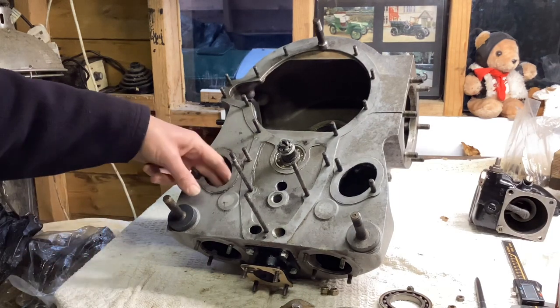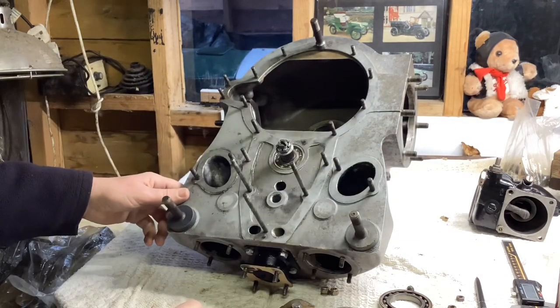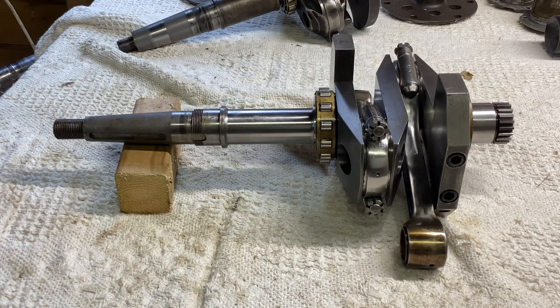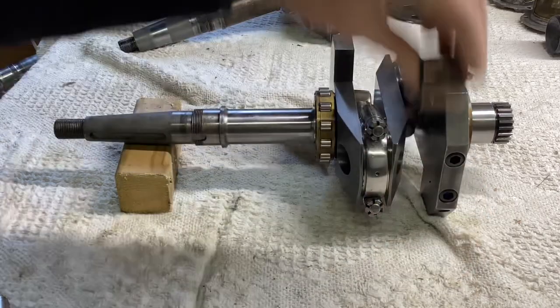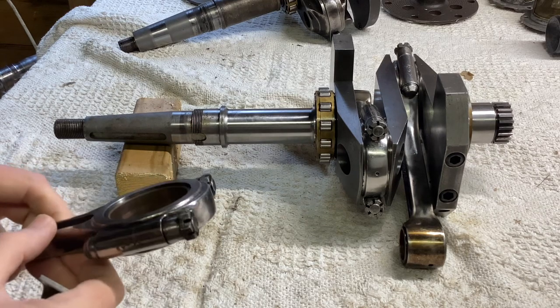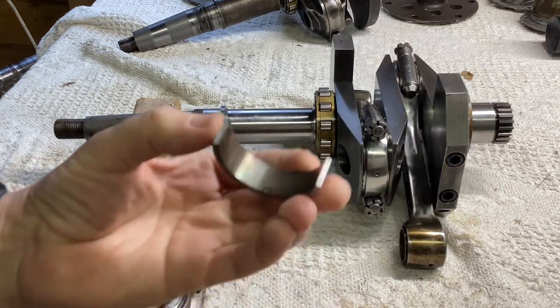For those of you who are still awake, we'll move on to crankshafts. This is a JAP 99 crank — for Americanists, it's the same as an E113C and D. That means it's the later crankshaft that has plain big end bearings instead of the roller bearings like the earlier Aronca crankshafts and indeed the Praga engine. So it just has a plain rod like so. I've got a set of new bearings here — they're a copper, silicon, cadmium alloy. When worn out, they can be relined with white metal, or as our American friends say, babbit.